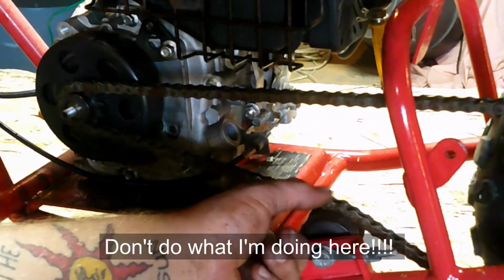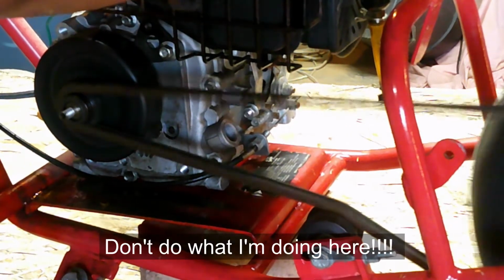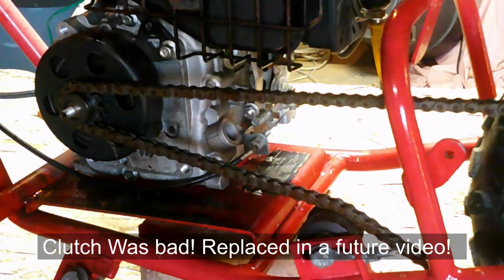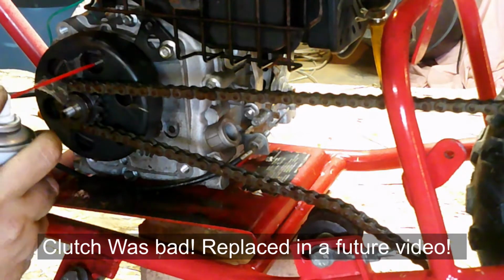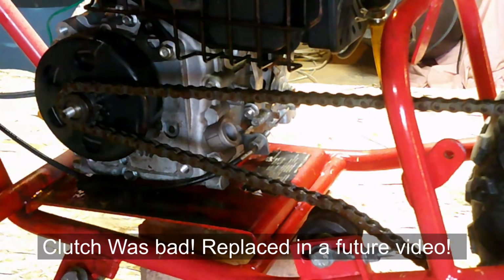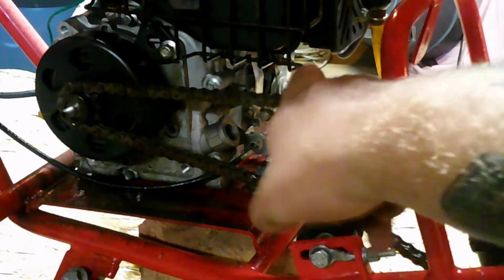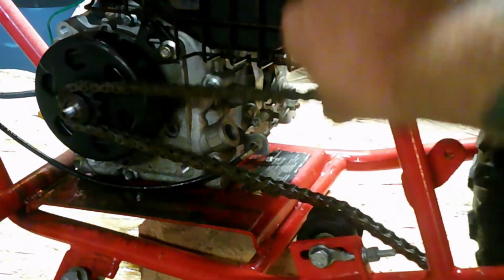So we might try tightening that chain. That should cause that, but I hear a real humming, let's hear. It sounds like a clutch bearing might be out in there. So what we're going to do is, it's spinning in there. Chain. It's still spinning in there and it's humming, but I think what it is is this chain is too loose, it bounces a lot.